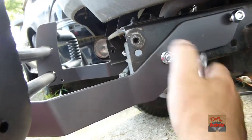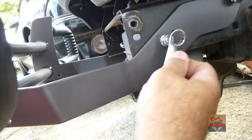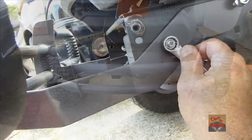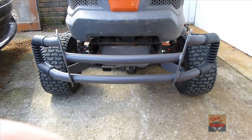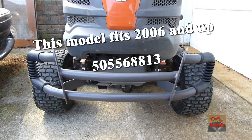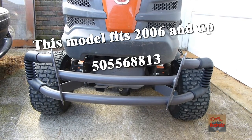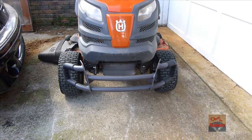You don't have to have a wrench on the back side because it fits in that square — it's like having a wrench on it. So tighten all four bolts up. Okay guys, there it is — it ain't very hard. These brush guards fit on different models, so just get the one that's for your model. I think most of the Husqvarnas are the same. As always, thanks for watching guys.